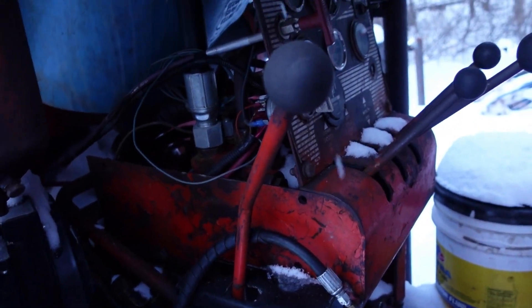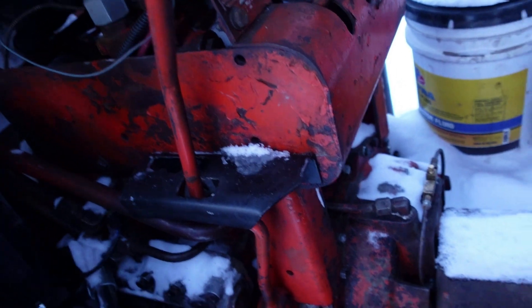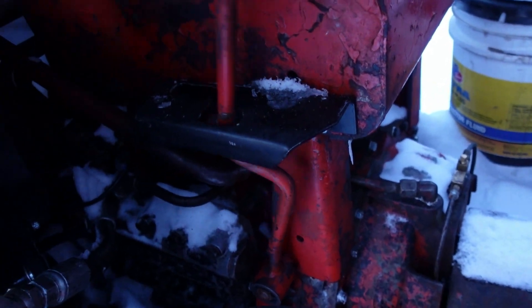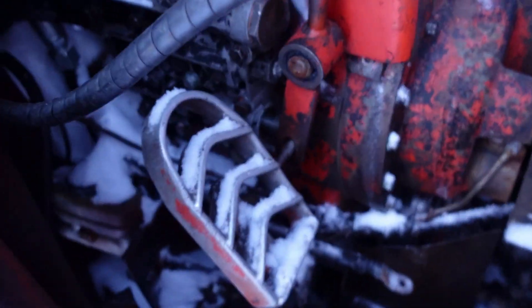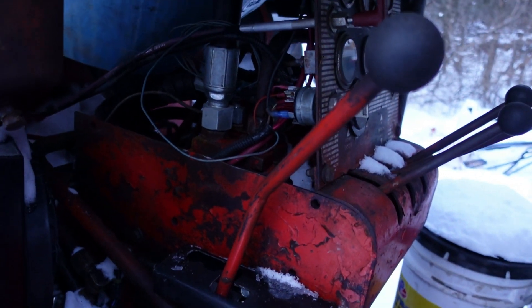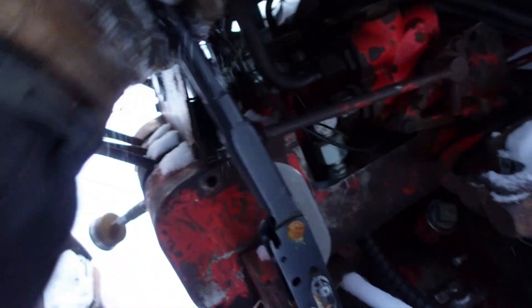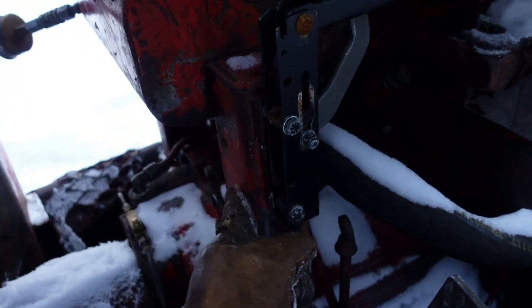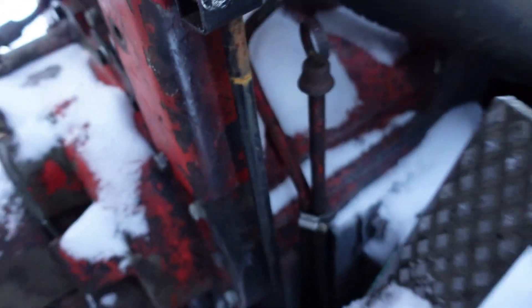I lost some footage, so I'm filling in here. Here's what I finally did with the shifter — the shifter's got a stop gate in there. Clicks, and a gauge stuck in here. Clicks up to the stop gate. Neutral's in the middle, reverse comes over, forward goes up. And I even put little notches in there so it actually positively stays. And it goes down to our shift there — so that worked pretty nice. And our parking brake here — I ended up flipping the handle forward because it fits better, otherwise it was hitting me in the knee. This bolted right up to the original bracket nicely. I made this tube here — sort of a clevis for the top — and it drops down, I got a slight bend in it, and it goes to my parking brake lever. Works great.